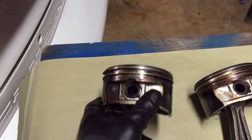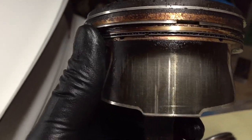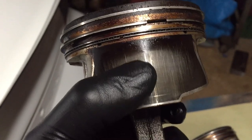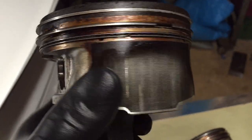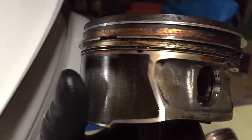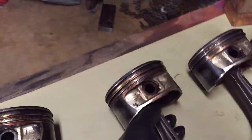Yeah, they're all about the same condition. Super happy I took this apart, because right before I did, I was considering just taking the chance and slapping it back in — and I probably would have come out with the same outcome: a spun bearing. Now with the pistons themselves, you can see that coating is pretty much worn off. But you can still see the factory grooves, and there's some scoring going up and down, going across — but they still ain't wore down past the factory groove under the coating. Maybe I can just have the surface re-coated — that's another thing I gotta ask the engine shop about.